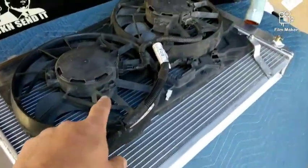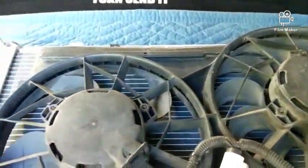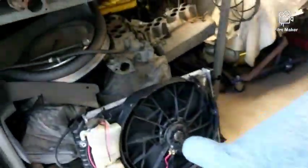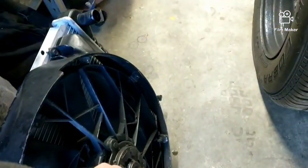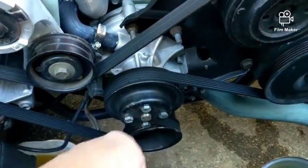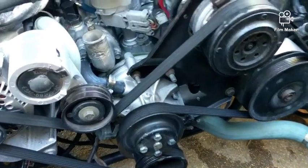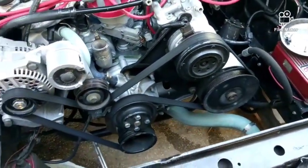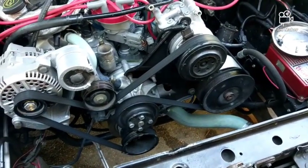I need to go back to — I think it was the Focus or something — fans on here. That's a Mark 8 fan but the fan motor rubs right up against where the water pump is, so I had to shave off a little bit of the centering pin on the water pump. But the good news is I think I can go back to my standard underdrive water pump pulley and get rid of the factory one.